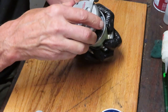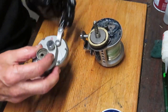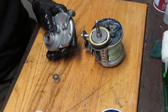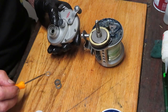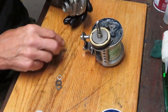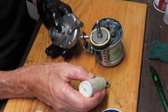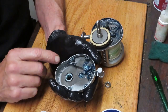This one's been neglected for a while. You can see a lot of old dried grease in there, and one big main gear which gives you the high speed. There are several tension washers on the front end of this case, so I want to take those out. There's a flat washer and then a bearing underneath that — notice the sequence, the flat washer goes on top of the bearing. The bearing's turning nicely. I'll take a moment to oil that bearing — it's a shielded bearing, so the oil will seep into it.